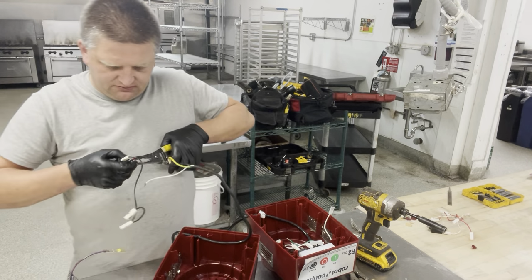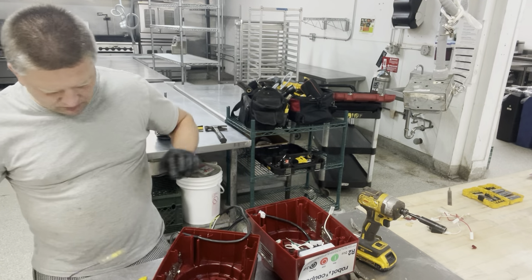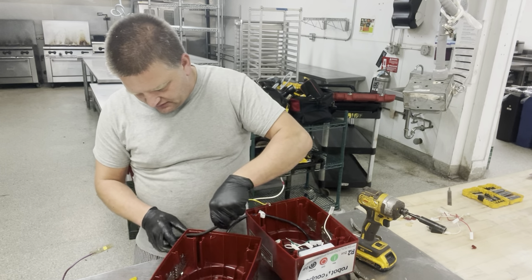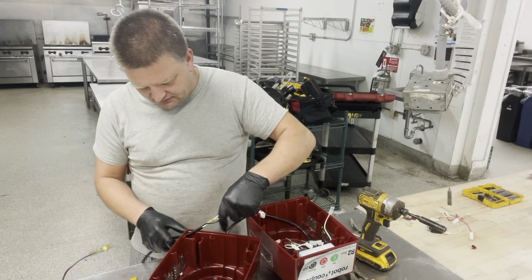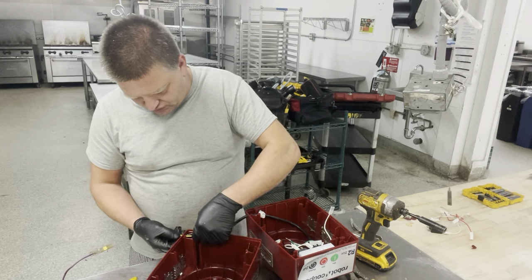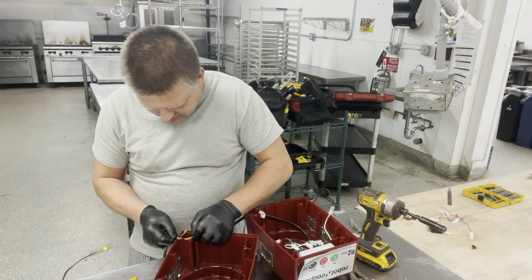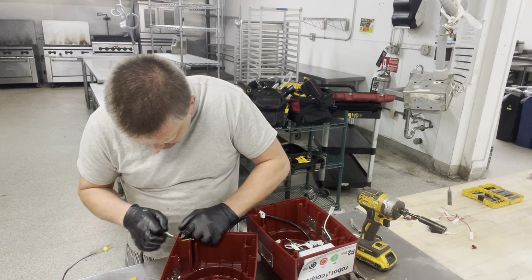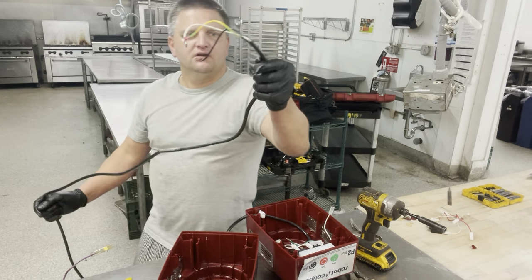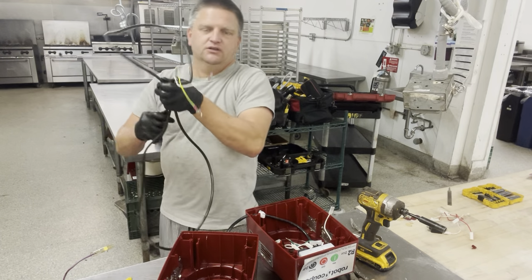So let me grab those pliers and take that safety switch off the hot wire and see if we can pull them one by one out of the housing. If not, I can just break the housing right here so I can save that cord. So go one by one, pull one strand of cord at a time. I'm going to try to pull the neutral first and see if it goes. There we go, ground and the black. So here is our cord. We're actually able to save it. Of course, it's still in good shape. I can reuse it for another unit or something.